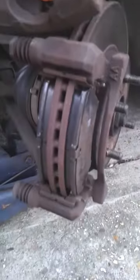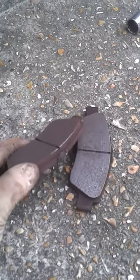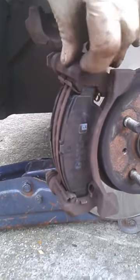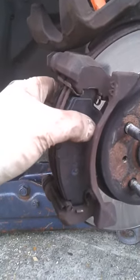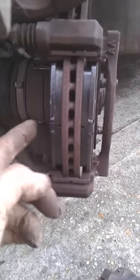These are the new pads. The old ones aren't too bad, but by the shape you'll notice a difference. That one goes in the back with this rather nice piece of metal up at the top. You'll see there's spring steel top and bottom and left and right. You'll have to gently push the pads in to engage — don't force it, and make sure you don't bend back any of those tabs.